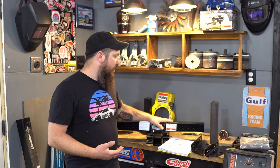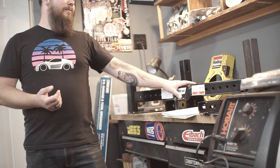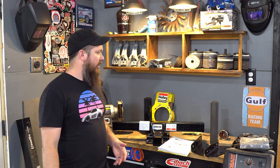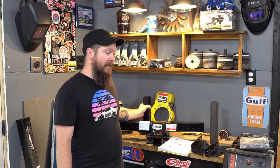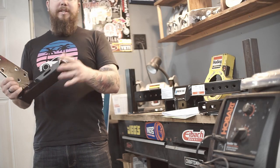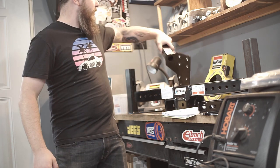So what I'm using is I have the Reese 37042 multi-fit trailer hitch model. And this is intended for SUVs, vans, pickups, basically like Dodge Caravans to S10s. And it's got an actual bolt together multi-fit setup. So these guys slide in, bolt can go through it, and there's a bunch of different places where you can bolt it together.